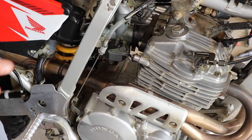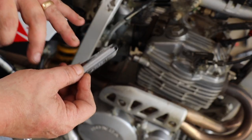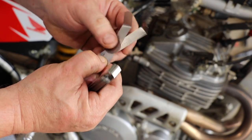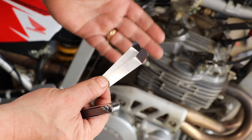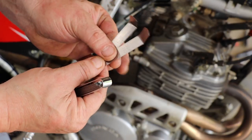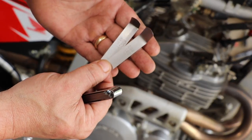Now this procedure requires some pretty basic tools, but there is one tool that you may not have, and that is a set of feeler gauges. You can get these at any automotive store — when you purchase them, make sure the set has the size you need. I've taken the two out that I need and bent the ends slightly by hand. This bike takes .005 inches on the exhaust side and .004 on the intake side. That's the only two I'll ever need.